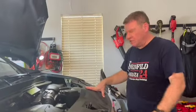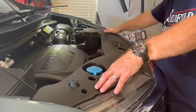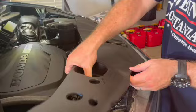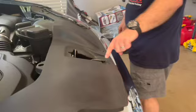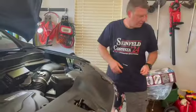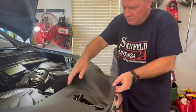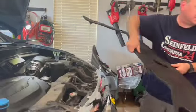This would also be helpful if you were changing the battery. This whole plastic cover here just pops off with no tools. Start at one end and start popping it off. There's a hood release clip that's kind of overlapping, so leave that. Start over here and then just meet in the middle and it comes off. Set this aside.